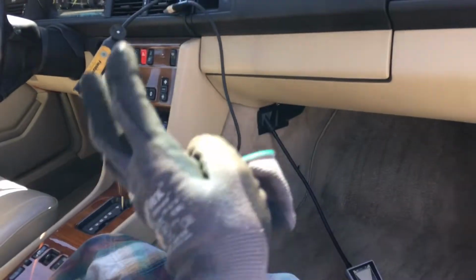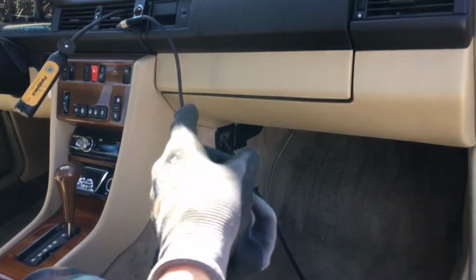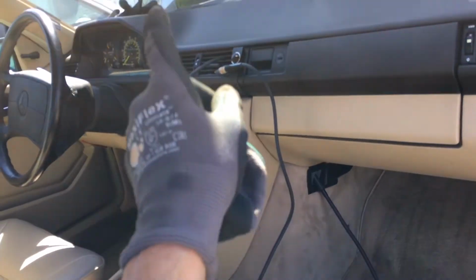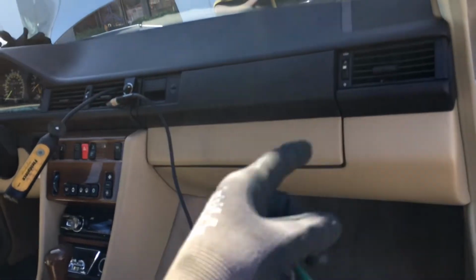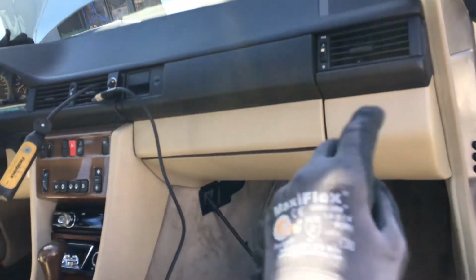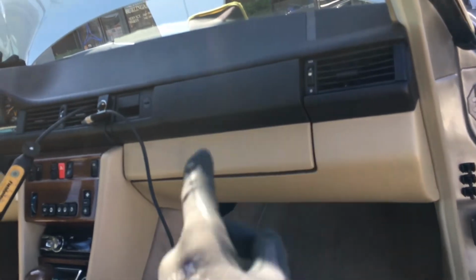Then after firing up, running it, proving that the thermal switch, the pressure switch for the receiver dryer operates, kicks on, the relay engages, contacts close, throws power down to the fan, engages and rotates at a specific pressure. That all works. So I know this car is not driving off with the secondary fan not working.